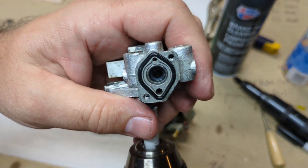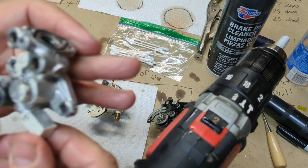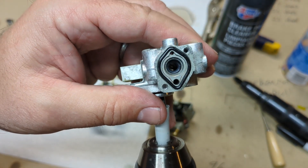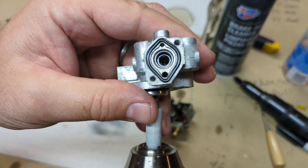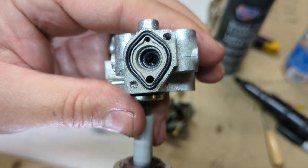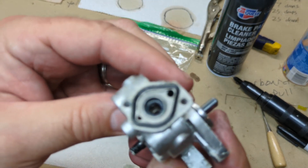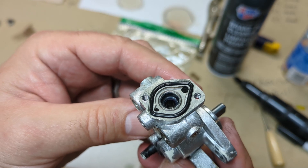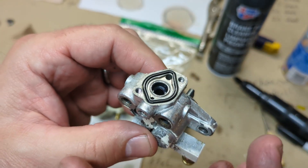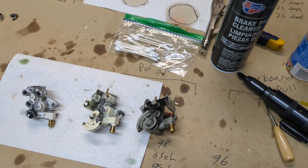I'm going to run this drill, and I'm going to open it to maximum wide open throttle because that's when you see the maximum motion of what's going on with these pumps. Do you see that? What's happening is not only is the piston moving up and down creating pressure, it's also rotating — it's spinning. And it's got little channels in there, so as it's spinning, it's sending oil to one side or the other.